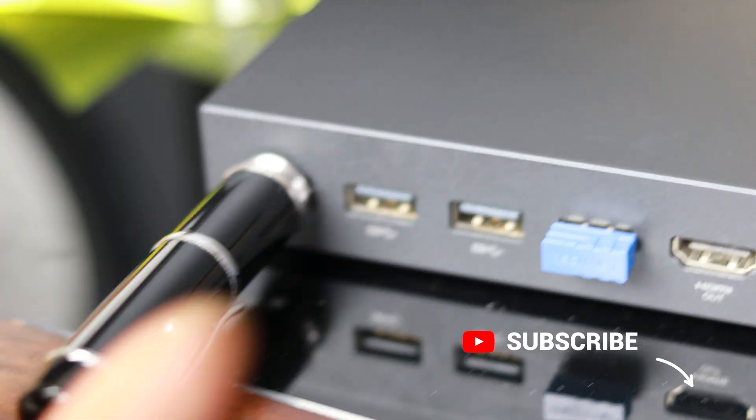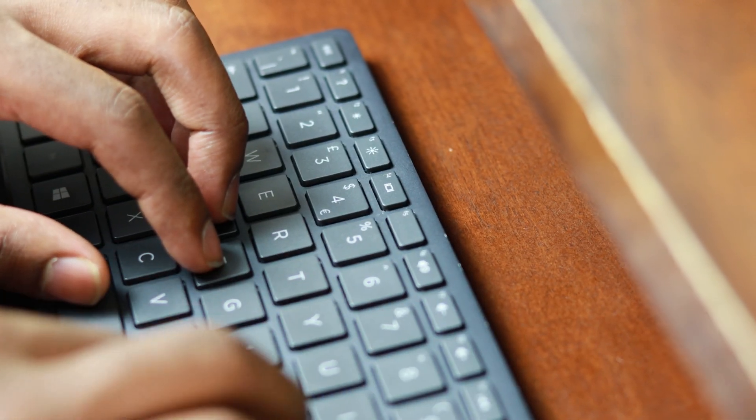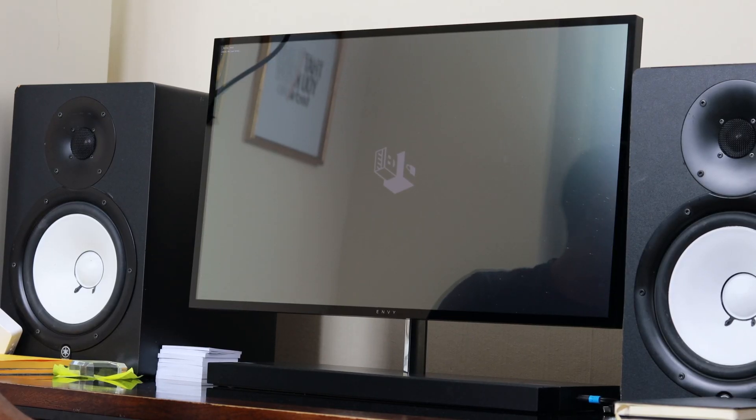So you can plug this USB into any computer. All you have to do is switch on your computer and get into your boot drive system — you can Google it and find the buttons online. For HP computers it's Escape, then it takes you to the boot menu and you can click F9. There you'll see the option to boot from a few drives — your normal drives and you'll see something else, and that's the USB. Select the USB and boot your system from there. The first thing you'll see is some data running on your PC. You'll see the option to run Tails — run it.